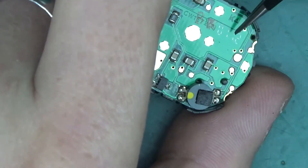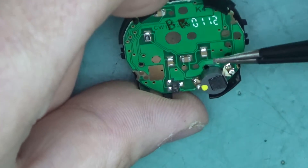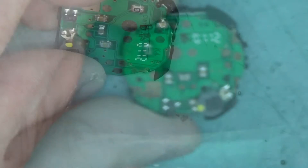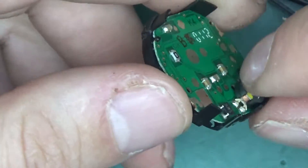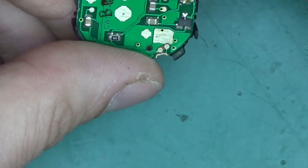Date code is 0112 — so January 2012 possibly. We have a few quite large surface-mount components: they look like 0805s — one, two, three, four capacitors and one resistor. The resistor value looks like 822, so that's 8.2kΩ. There's also a small transistor. The large component is a transformer — it has four connectors.